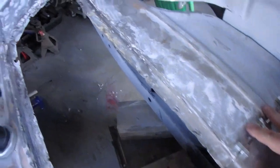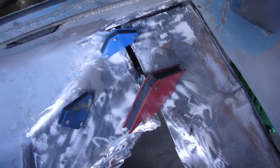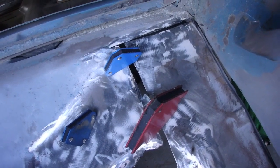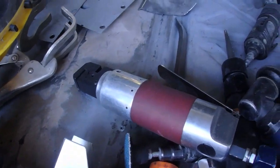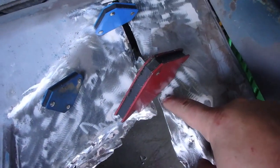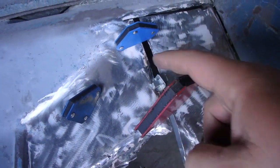So just fitting this piece up, and this is the dilemma I came up with — I knew it was going to happen since we had to skirt it over: we've got that large gap there. Now I think I'm going to use that flange tool right there, and we're going to put a flange all the way up. That way the piece of metal I'm going to have to add will overlap and then connect onto the main body.